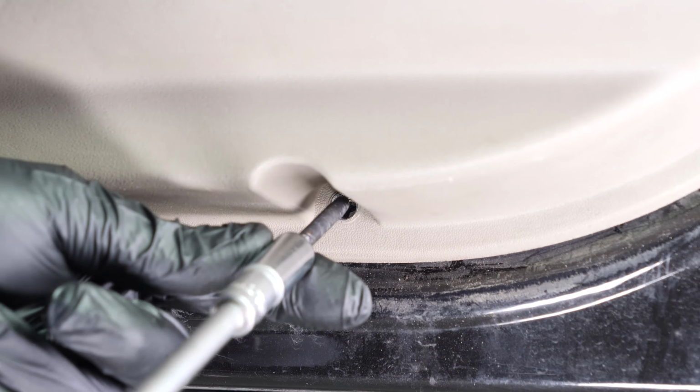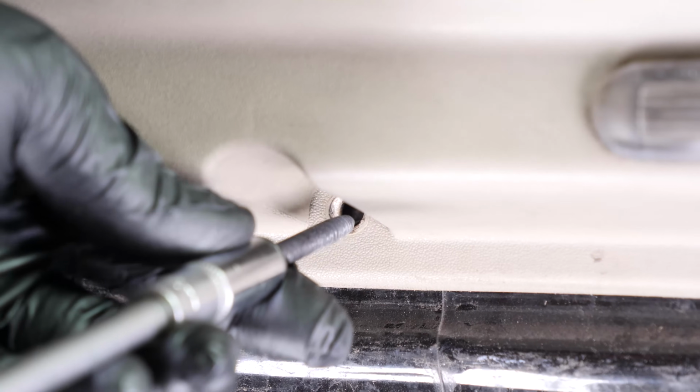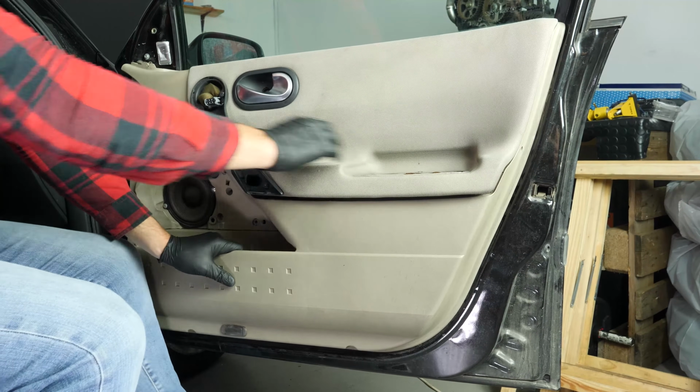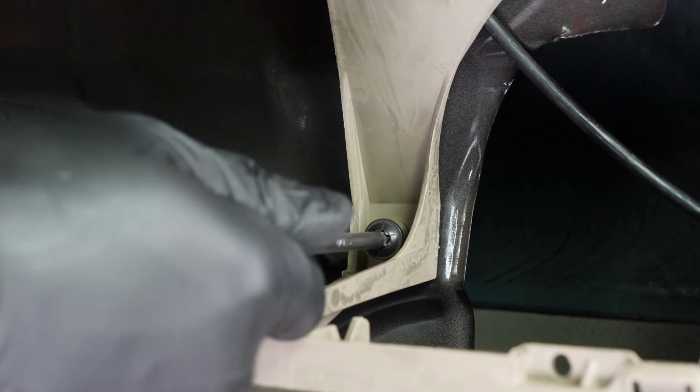and start by screwing in the 2 screws on the foot of the door, which connect the trim to the window control mechanism. This will help avoid disassembling everything if there's an issue with alignment. Lift the upper part of the trim, then screw the holding screw back in.